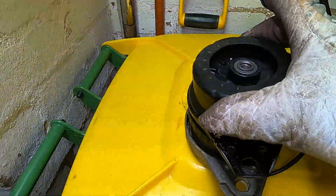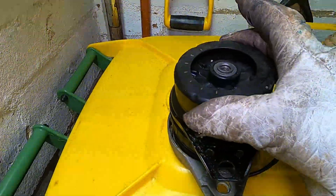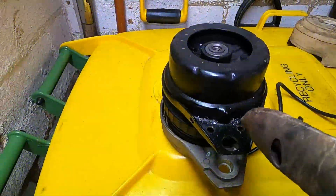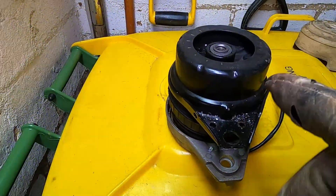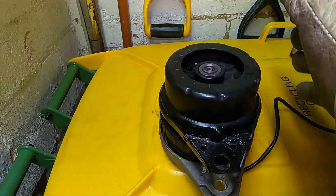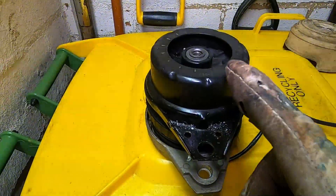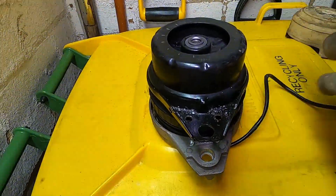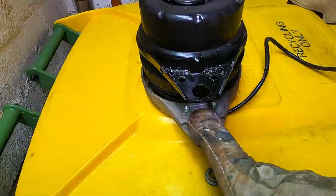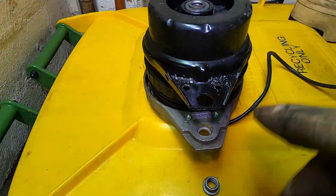Next piece is the metal protection anti-separation part. This is what saves you if it's your left hand engine mount - when you accelerate the engine lifts up on this mount and that's what caused the failure. It's only this piece of metal that's stopping your engine from completely pulling free, and it's riveted down just on these two aluminium casting rivets.